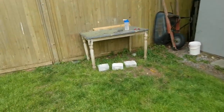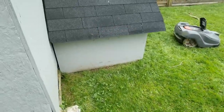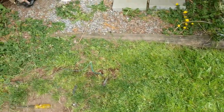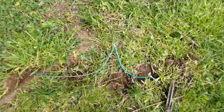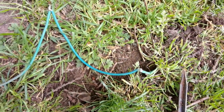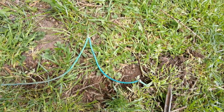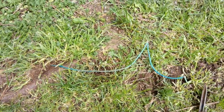I've been going around and around in circles with this wire tester, and guess what? I found the break. I was coming from the base station and it had a nice loud signal — loud and loud and loud. And then when I got around to this side, it stopped. So I pinpointed it to be right over here. And check it out — there was a break. I've attached new wire, but it was just really, really worn out. I'm not sure what happened. I didn't expect it to happen right here, so close to the station, but that's where it was — not over where the sidewalk issues were. Super surprising.